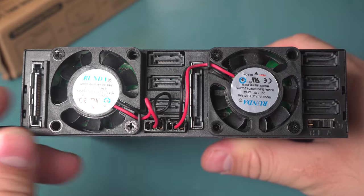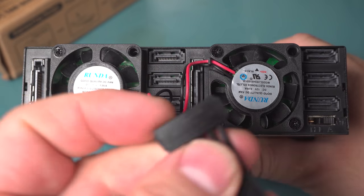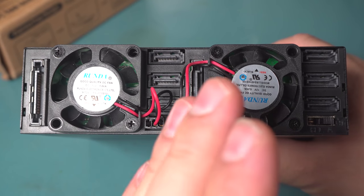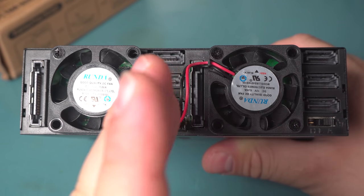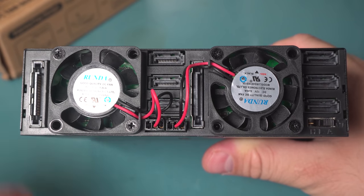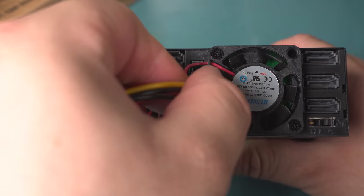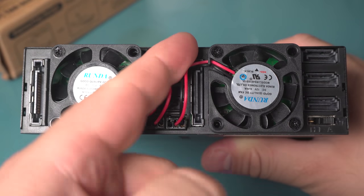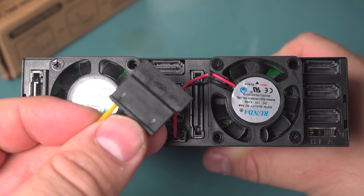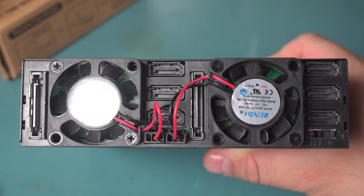I'd rather it exhaust out through the caddies and let all the air intakes on my server with filters handle all the incoming air, so the dust is at least filtered out. One thing to note about the SATA power connectors is that they're very close to the fan, so using a 90-degree angled power connector is very difficult. Depending on the connector it can actually bend away, and I would not recommend using it like that. A straight-through connector works fine — it just plugs right in. You might need an extension cable or some other adapter if you only have 90-degree power connectors coming off your power supply.